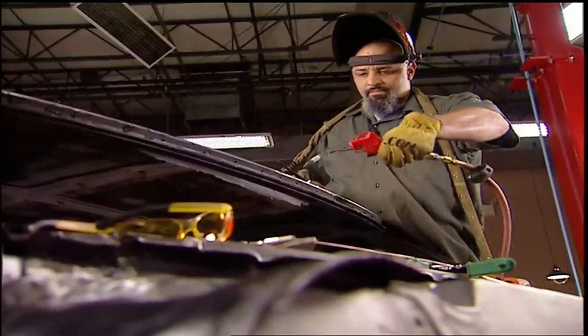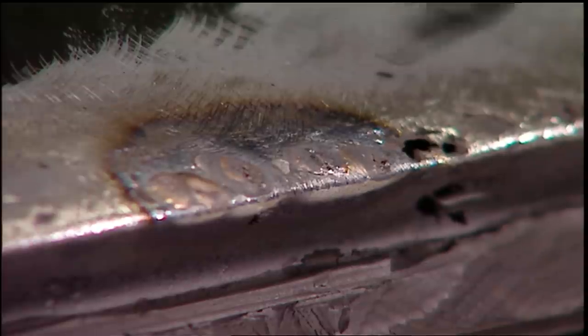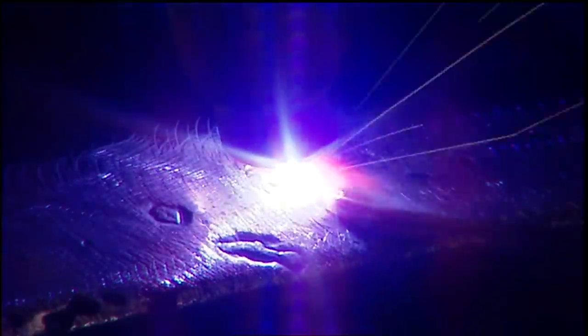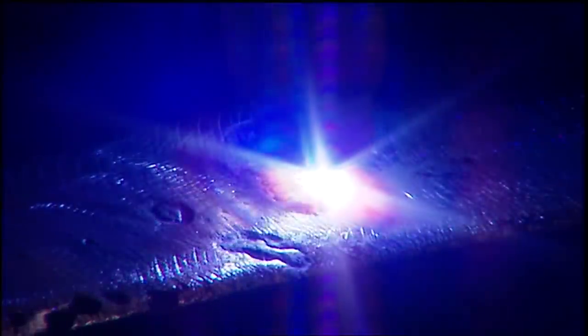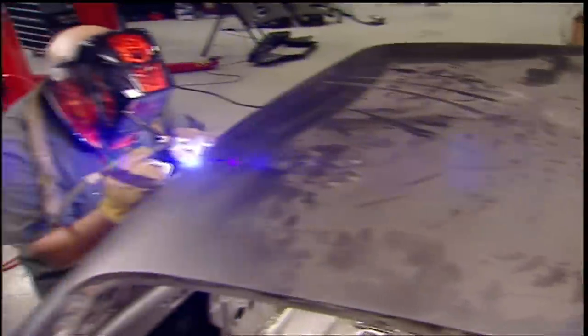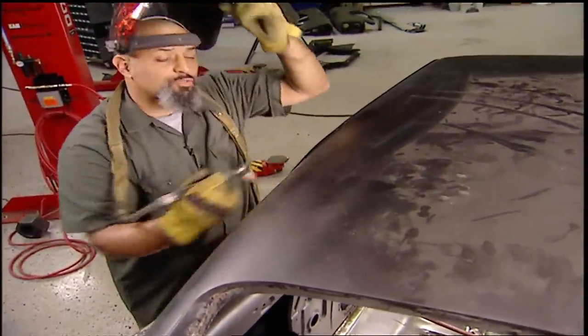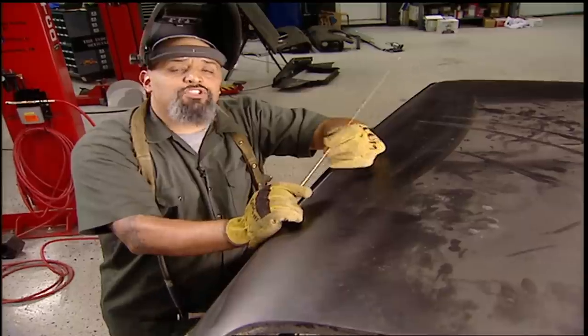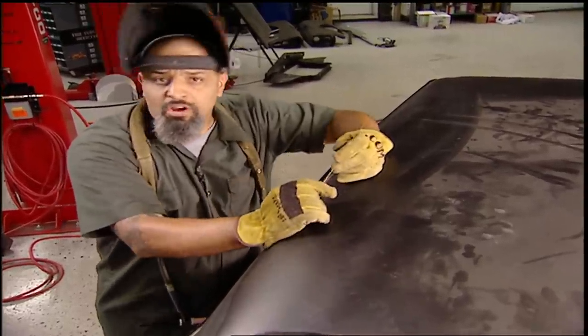Take a look at how I see it through my mask. The rod melts quickly, so I move it over until the body gets hot enough to suck it into the hole. Notice how quick it cools down. I'm not just reliving my childhood here — this really works, and it's becoming so popular that these rods aren't hard to find.